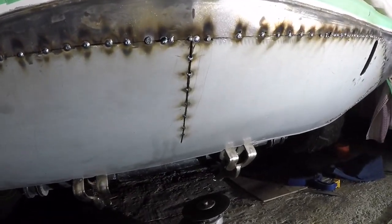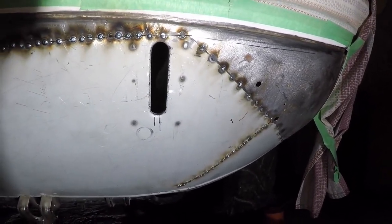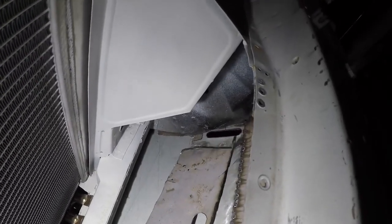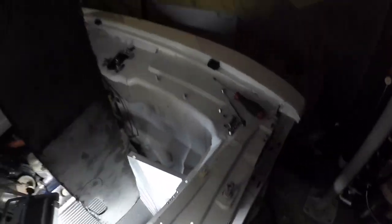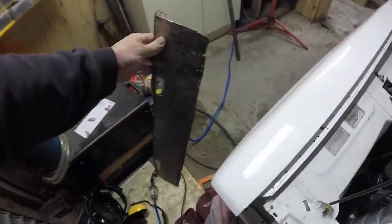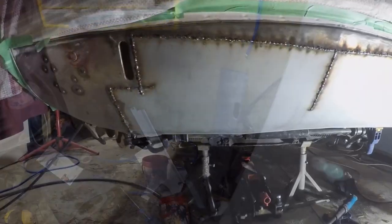What that does is it means the two panels are being supported the whole time you're doing that process, so you can get the panels lined up very flat and flush with a square edge butted up as well. Then it's time to pull the old pieces out from the back side — we don't want to leave those there. Sometimes they can get hung up with a little bit of weld, but you just give them a wiggle by hand and they'll come out. You may have to cut them into sections, and sometimes you can do that beforehand if you can't get the angle grinder in there access-wise.